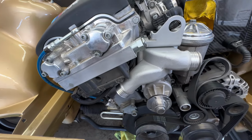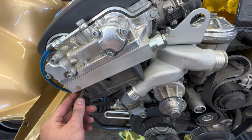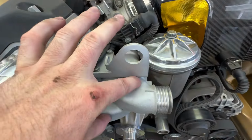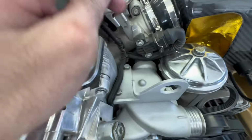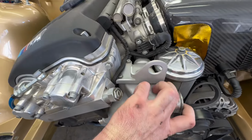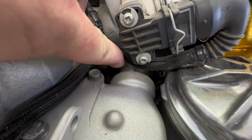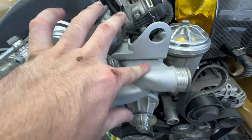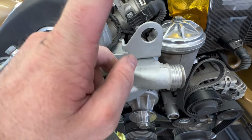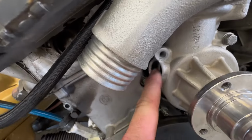All right, so we've got that bottom filler hard pipe removed. Now I'm just gonna disconnect the Vanos connector right here, move that out of the way, and then I believe the water neck for the thermostat housing is just 1, 2, 3 bolts. Remove those and basically pull this out. So it's just held in by the 3 bolts and then an O-ring back here. So once this gets removed, obviously I'm gonna have to get these welded for the end fittings. Other than that, that'll help me get a clearance so I could actually tap in the freeze plug right here.